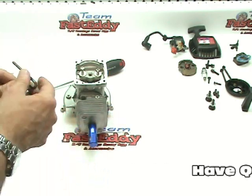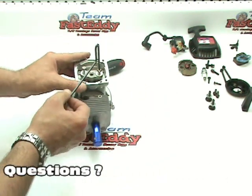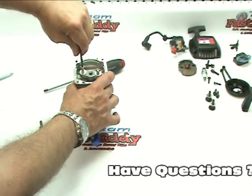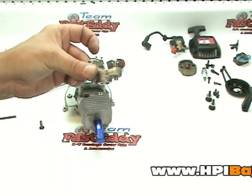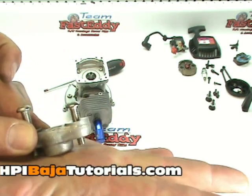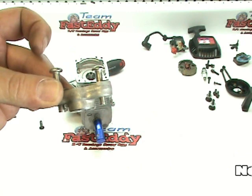Then you're going to go ahead and use your wrench and just give it a small turn. Switch over to the other side, give it a small turn, and then you're going to hear it pop and the unit is going to come right off. You can see that we basically just use these screws to push against the plate as we're tightening them up, and it pushes it off of the shaft.